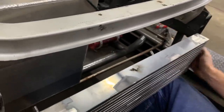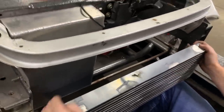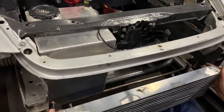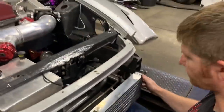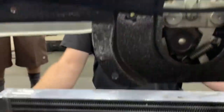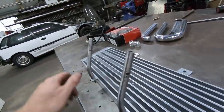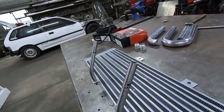That attaches to the lower bar, and then I can also build top mounts that come off of it as well. But it looks like I've got to put the front bumper back on to see where I need to get my height for my reveal. Marking length on these for where I have to cut and notch them to attach them to the other bar.